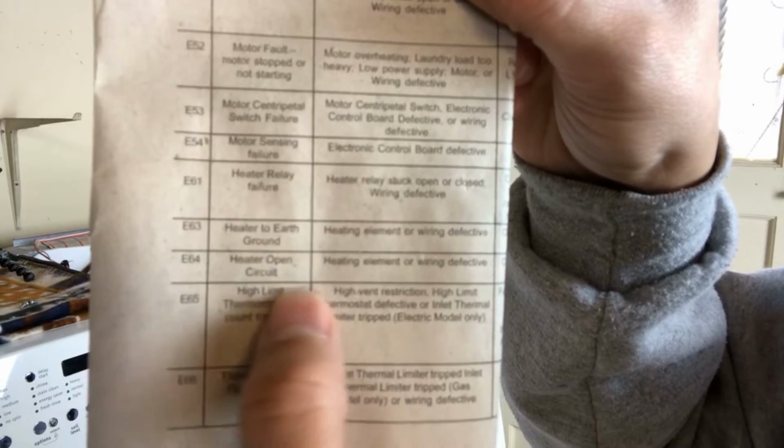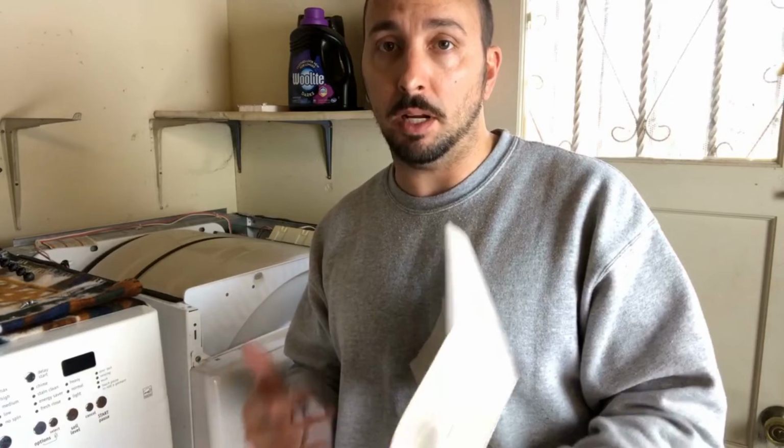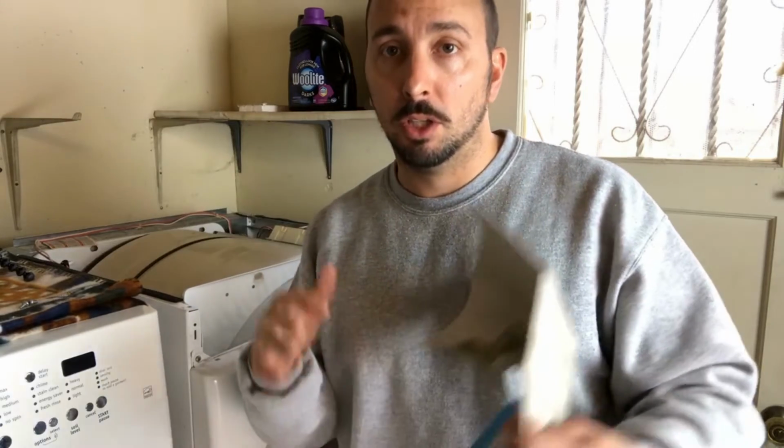Okay, so I already did my research on this, but if you want to see it, it's right here. E64 Heater Open Circuit. Okay, it says heating element or wiring defective. So in my case I already knew it was heater element, so I bought a new heater element on Amazon, and I'm going to be linking the link on Amazon in the description box below. So just in case you want to see which one I bought, I'm going to show you guys which one I bought in the description box below.